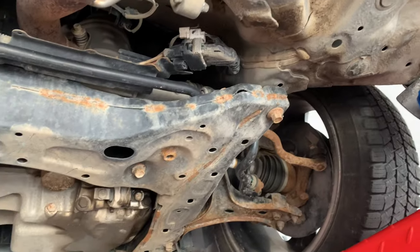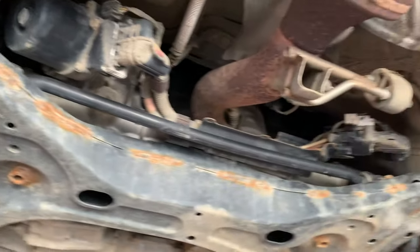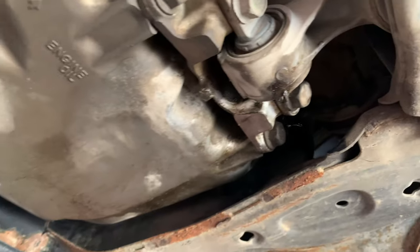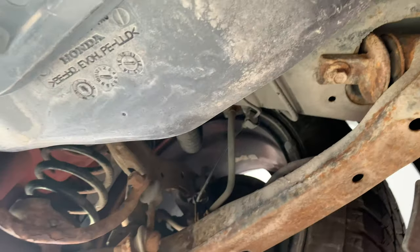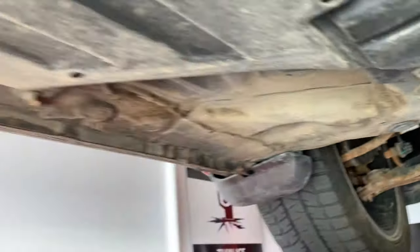Here's how the bottom looks. As you guys can see, there's quite a bit of rust on it — the subframe especially. It's truly bad here. Given that the car is about 11 years old now, it's obviously wear and tear. That's basically how it is with the weather we're having here in Calgary. The winter we're having is definitely not bad at all. The pinch weld — nothing serious there. I don't see any major rust, but you know what, that's where it starts.